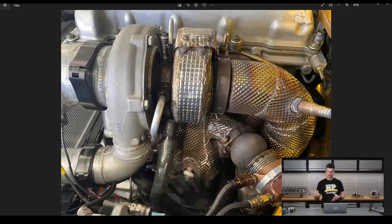It is stainless steel after all. This is also available in an Inconel product, and talking to PR Tech, they tested back to back the Inconel and stainless variants and essentially found no advantage with the Inconel, but it comes at a significant increase in expense, so they've decided stainless is absolutely fine. We probably will end up doing something about the wastegate which is currently exposed, and we've got our existing heat shield on the turbine exhaust housing. Initial testing looks positive — engine bay temperatures were significantly cooler, but it's still hard to tell until we run the car under proper race conditions for a one-hour race.